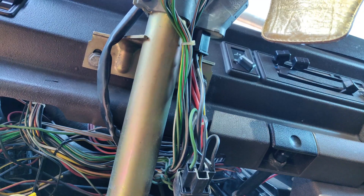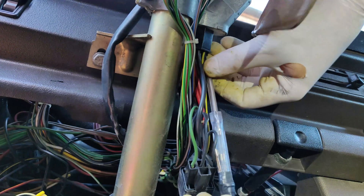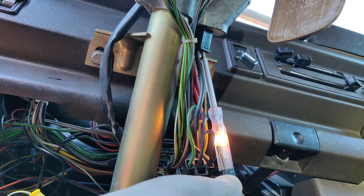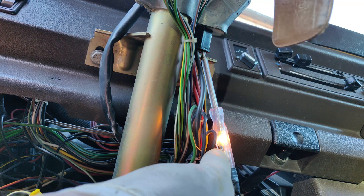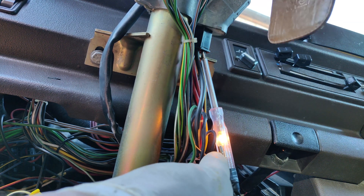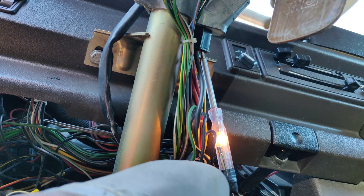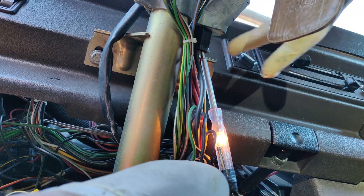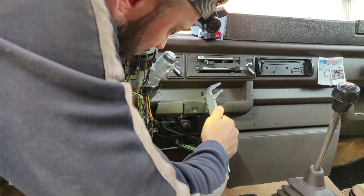The accessories wire — yellow and black — in the first ignition lock position I have a positive signal, and in second position also. So this is with the ignition on, and this is for the accessories. I'm going to feed the voltmeter from the first position. Now I want to widen the hole.